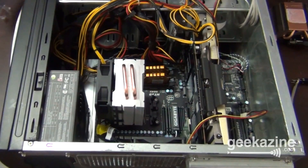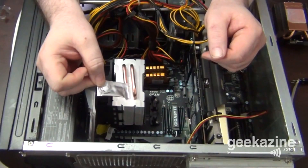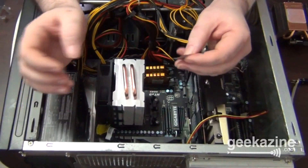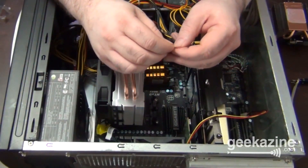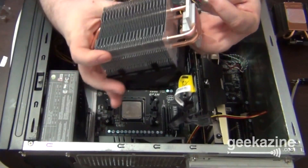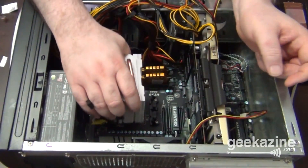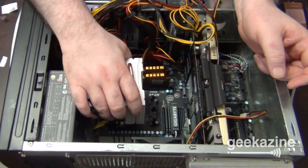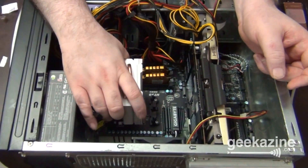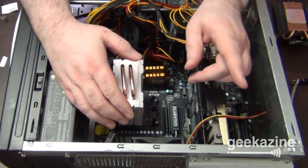Let's go into the next step and find my thermal paste. Like I said, I don't see any problem with this thermal paste. If you want to buy more powerful thermal paste, I know there's better thermal paste available — some say they work better at higher temperatures — but I pretty much trust this stuff. So now we're going to set this down and, like I did in my previous video when I put this machine together, I'm just going to smoosh it around and bring it back up, smoosh it around. Now we've got more than enough thermal paste covering the whole processor, and that's the important part.